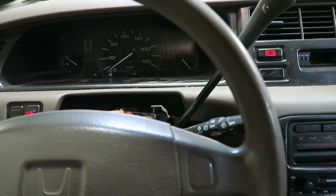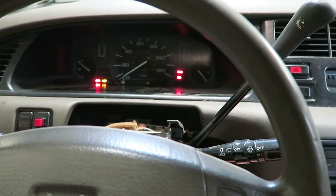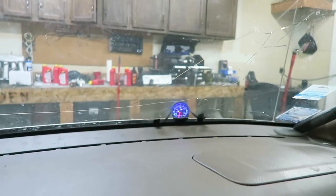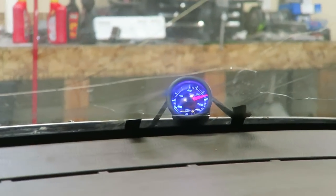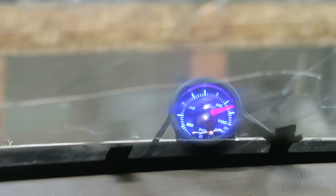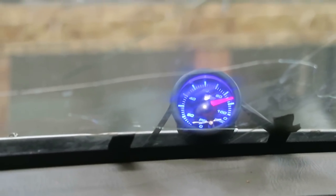She's all back together, good on oil, and we're going to fire her up and see what our oil pressures are like. We're also running Schaefer's 20W50 now, a little bit of a thicker oil — same stuff I run in the hatch. Let's see how she does. Oh yeah — way more! We're just under 90 PSI. I could easily rev it up to 100 if I wanted to right now, but that's still cold. She almost hits 100 PSI just revving it at a cold start with no load.